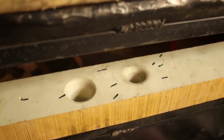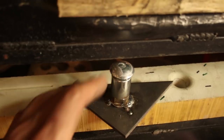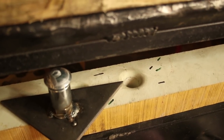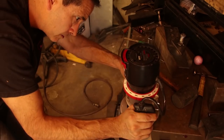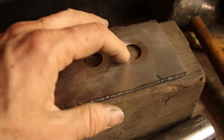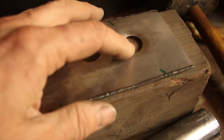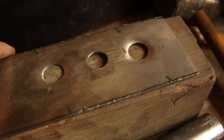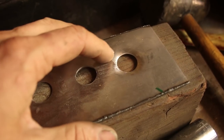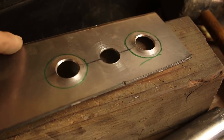So now that I have a heavy duty ball here, or this part of the die, I think I'm gonna try to go with a chamfered hole and see if I can't get a sharper corner. This is the new kind of squared off hole, and this is the new one, and it is slightly more crisp. It's not crisp by any means, and that's really the difference between high quality tools and low quality tools, is how crisp that outer diameter is. So let's do it.